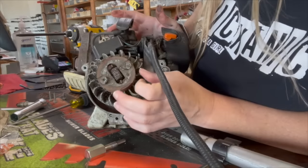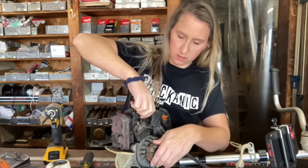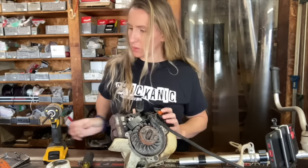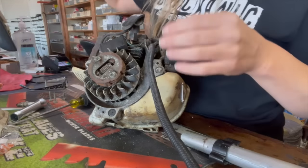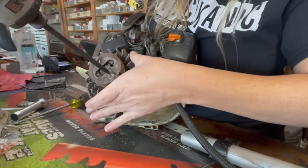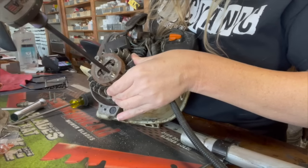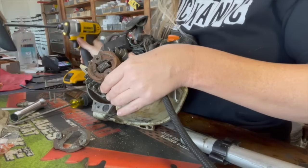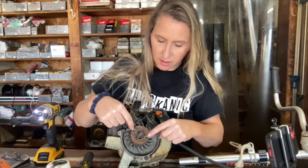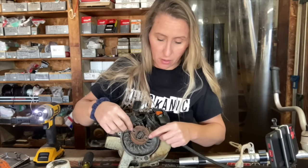It actually has 10 millimeters instead of T27s. So we're going to put the piston stop in and get this clutch off. Now we're going to use our T27 to get these screws out. We've got it locked into place so it just makes it easier. It's so rusted — I don't want it to strip out in the center. Now the new clutch does not come with this plate. It also does not come with the spacers or bushings inside for the screws to go through. Hopefully these will come out; if not, we're going to replace these bushings also. They're really stuck in there, so let's try to get this plate off.